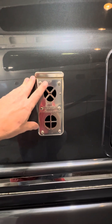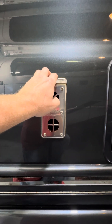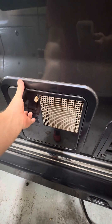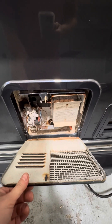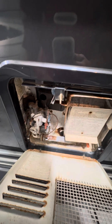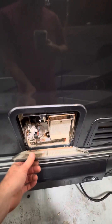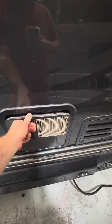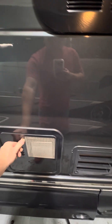Directly above that compartment is your furnace intake and exhaust — anytime the furnace is running, this will be blowing out hot air. To the right of that is the water heater, a six-gallon strictly propane unit controlled from the inside, which I'll show you. At the very bottom there is a drain plug that is also the water heater anode rod. A brand new rod has been installed, so it should last at least a season.